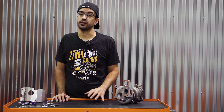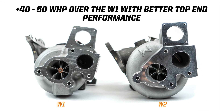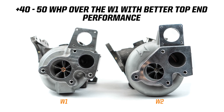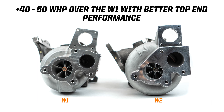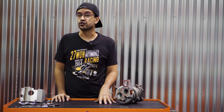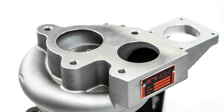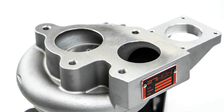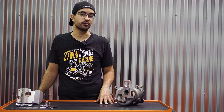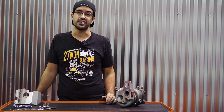So how does the W1 compare to the W2? On average, you're going to see about a 40 to 50 wheel horsepower increase on both pump gas and ethanol. Because of the larger housing, spool is going to be a little bit later and come on a little more up top, but you're going to be able to carry much more power on the top end as well. So whether you're looking for closer street-like performance or really high-end performance, we've got you covered with both options of turbochargers. We're really excited to bring this to market. It's taken a lot of time and effort to make this product come to life. As always, thank you for tuning in, and I dare you to redefine the aftermarket.